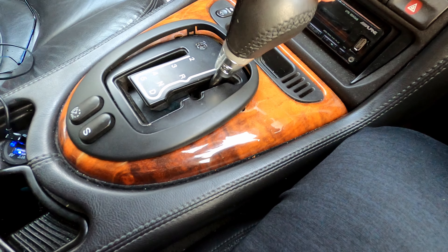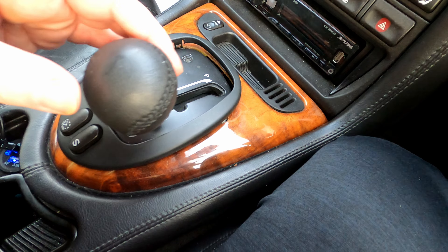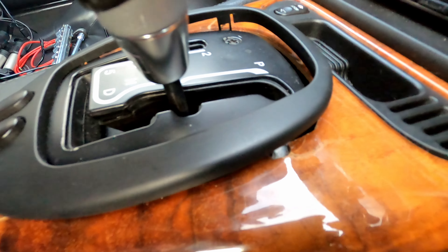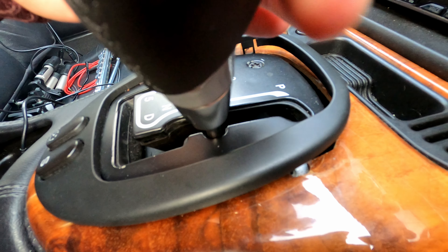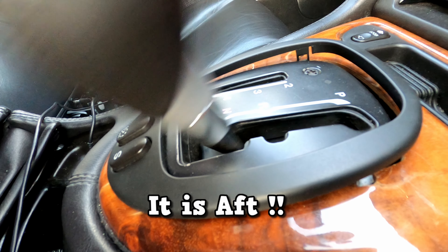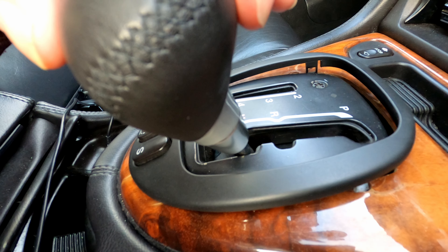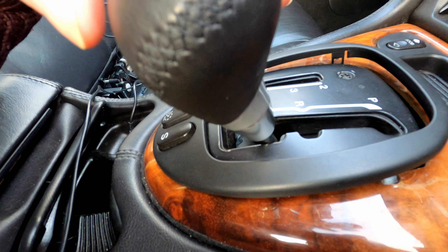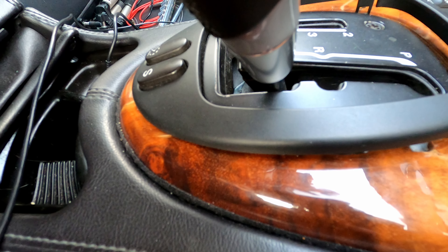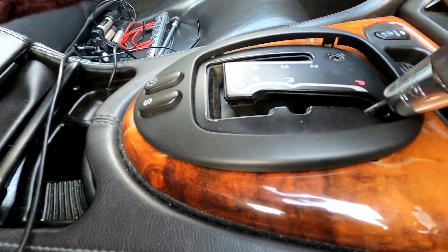With my foot on the brake I can take it out of park. You can feel it going to reverse and you can feel it going to neutral. When it's in reverse you can see it's sitting slightly forward at the reverse notch. Put it into neutral and there's quite a gap between where it sits and the neutral position. I'm going to adjust the cable slightly so it sits a little bit further forward, and I'll demonstrate how I do that and how that compares to what the service bulletin says.